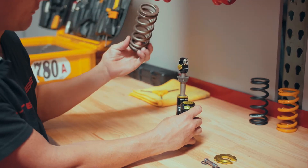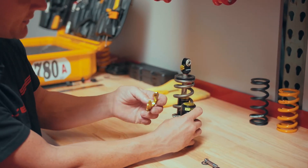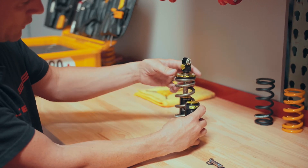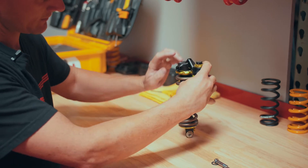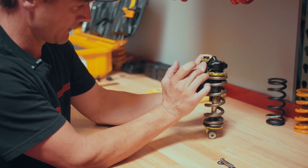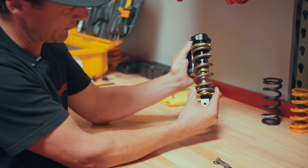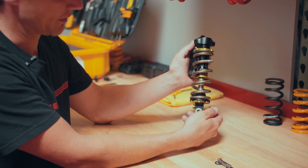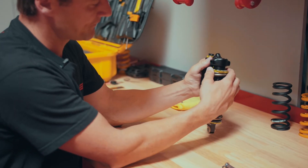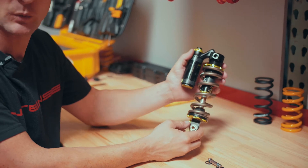Go ahead and put the replacement coil spring on in reverse order — spring on, then put the lower spring plate on the same way it came off. Hold everything in place, flip the shock back over, and screw the upper spring plate down to the coil spring until it just starts to bite the coil with no movement. At this point spring preload is at zero. Our minimum spring preload is 1.5 turns, so we'll start at 1.5 turns. Coil is reinstalled — we can go ahead and reinstall this onto the bike.